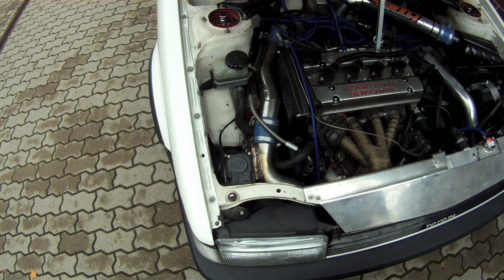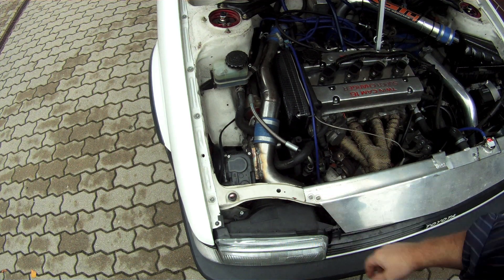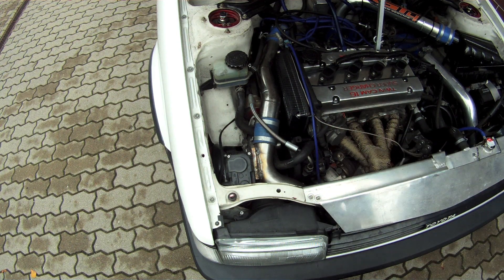Because this is an electronic throttle body, it's operated by the standalone ECU. I open the throttle body at certain RPMs, so it's not dependent on vacuum — it's dependent strictly on RPMs. Currently I'm opening the bypass valve at about 5,000 to 6,000 RPMs, and at the same moment I disengage the supercharger. So both happen simultaneously: the supercharger disengages and this valve opens, and the turbo starts sucking nice cold air.